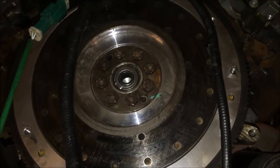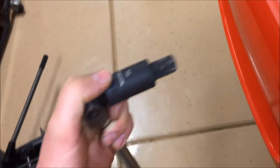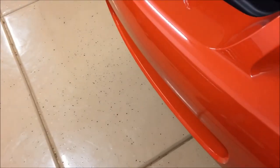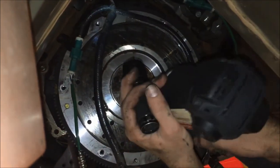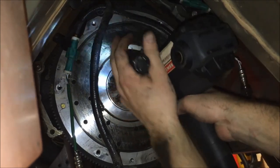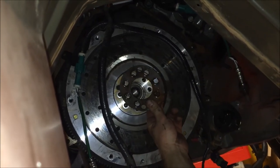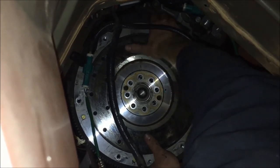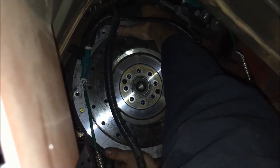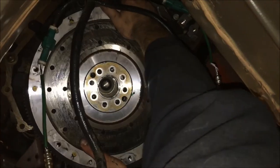In this video we just didn't resurface it. Once again, take that 14 millimeter hex, put it in the front of the crankshaft, and hold that still while you break the flywheel bolts loose. They're going to be 17 millimeter and there are eight of them on the Cobra and Mach 1. If you don't want to use the breaker bar in the front of the crank, you can use an impact gun for removing it, but definitely not for tightening. With all the bolts removed you can also remove the little ring plate, then the flywheel comes off — it's only held on by dowel pins, so rock it back and forth carefully. It's not too heavy on the Cobra since it's an aluminum one.